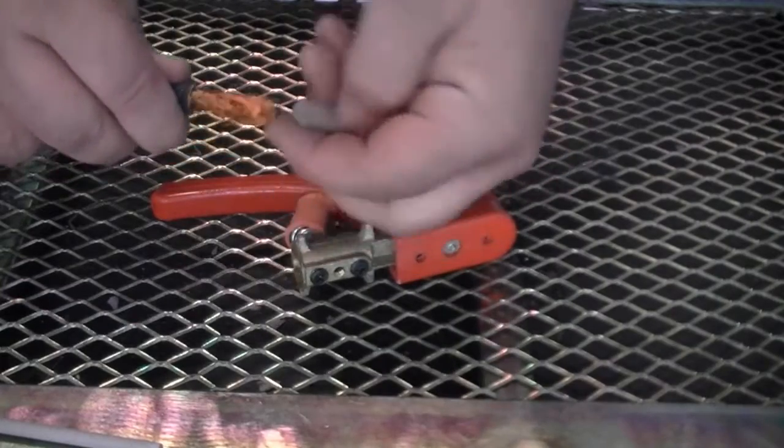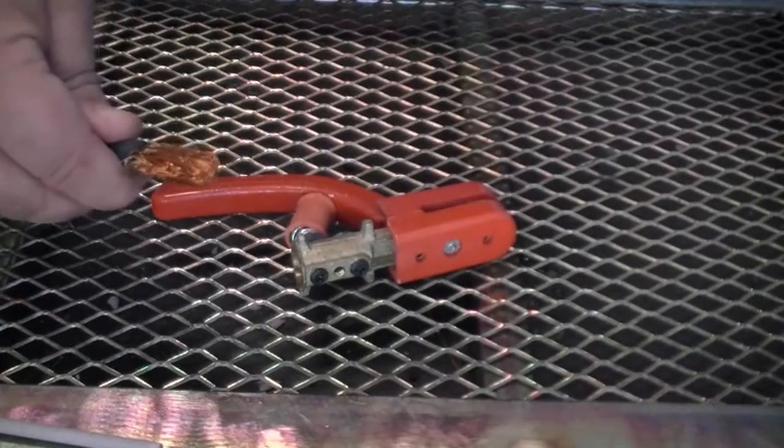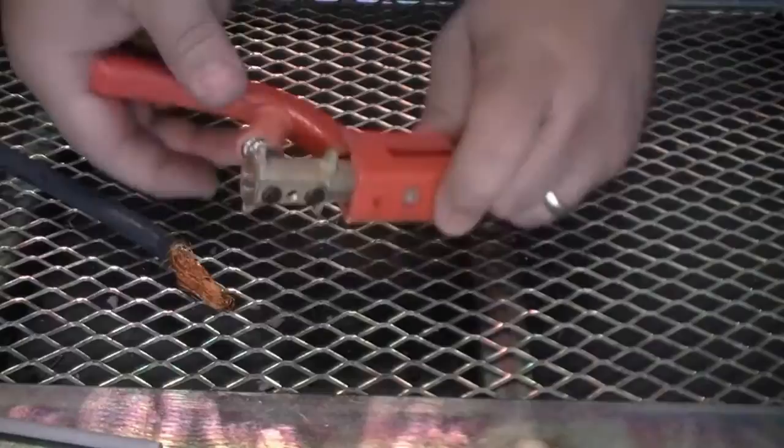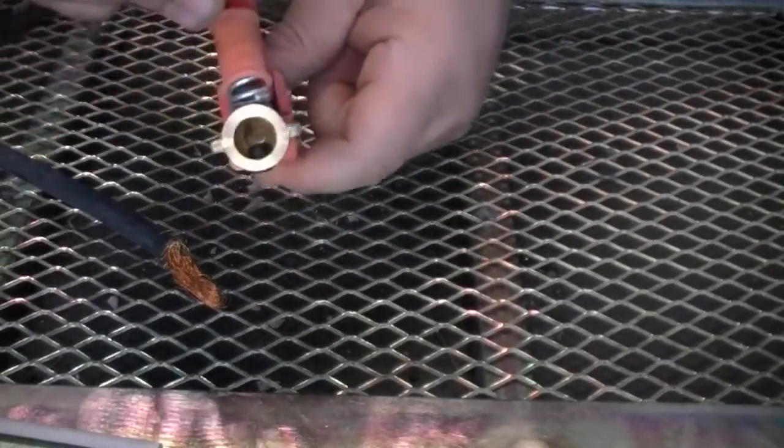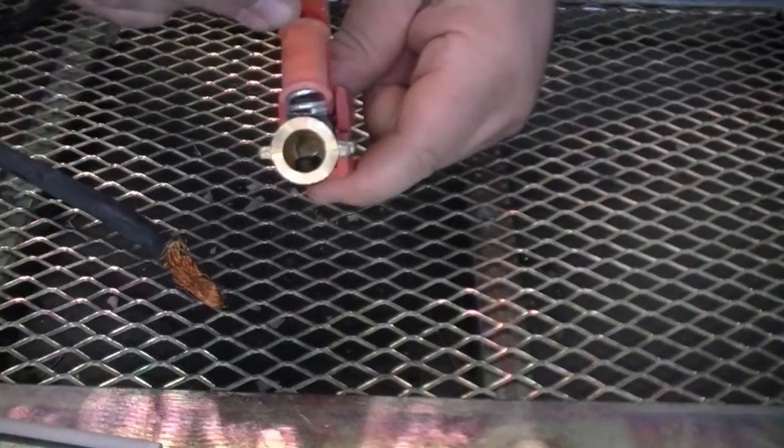Notice the small copper or metal shim that is inserted with your cable — keep this for reinstallation. If the shim is missing or unusable, a small piece of soft copper pipe cut to length and then cut down the side so it can be compressed will substitute just fine. Unless you are lengthening and upsizing your cable, you will likely have a gap between the hole in the holder and the cable. The retaining screws will have plenty of adjustment to compensate if you use the spacer. The stock cables are appropriately sized for their length and amperage rating.